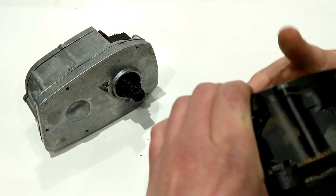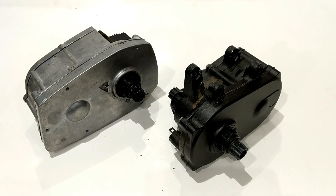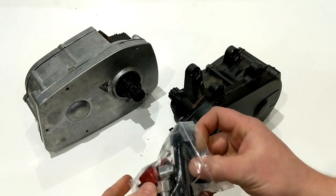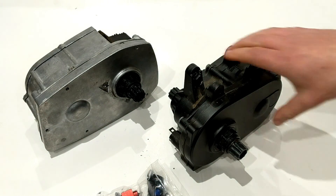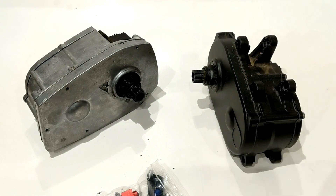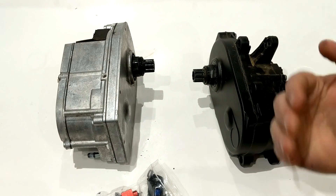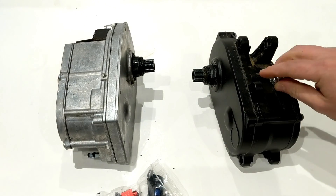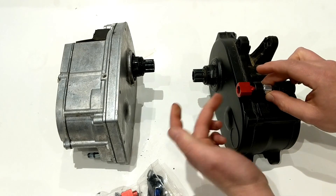One notable difference is that there are no standoffs on the 2.1. On the magnesium casing, everything is installed without threading directly into the casing — there's a bag of parts that facilitate installation. On the right side, there are red standoffs where a threaded nutsert presses in and locks in place with a hexagonal design, and then a red insert acts as the motor mount.